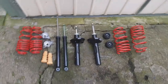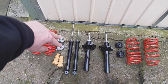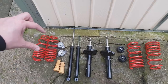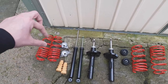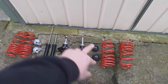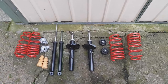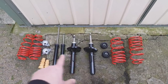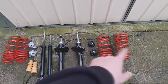We've split the suspension into two sides. Rear: dampers, bump stops, top mounts, and springs. These are progressive springs — more coils at one end, fewer but wider apart at the top. The closer coils handle small knocks and bumps, and the wider ones handle the big hits. Then we have the front dampers, top mounts, and front springs. Massive thanks to Kieran for providing the rear dampers, one of the fronts, the top mounts, and bump stops — I only bought one damper and the springs.